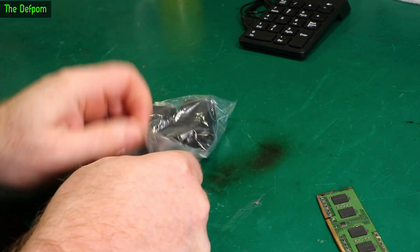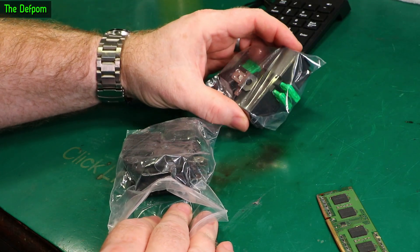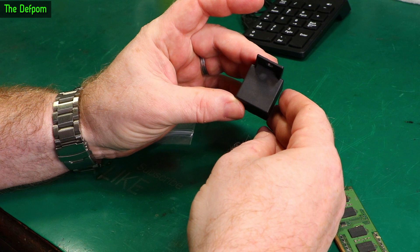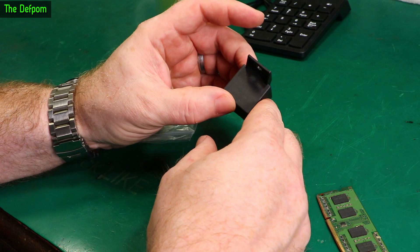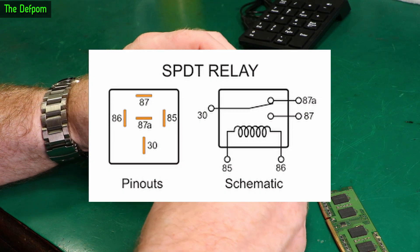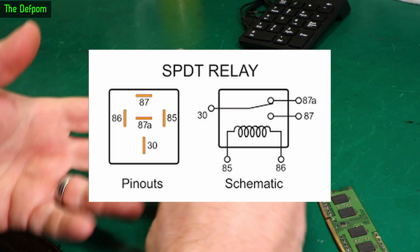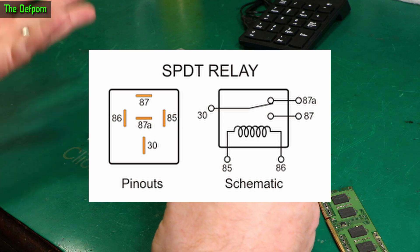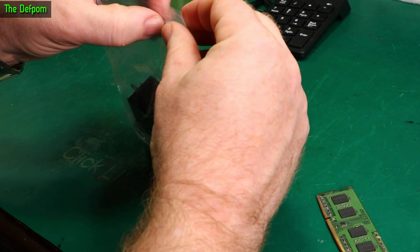Relays. So I've shown some relays previously, which are still sitting on my desk actually. I need to put these in my car. It's just a little 12 volt relay, 40 amp rated apparently, with 87 and 87A terminals - so it's a changeover relay. I just like to have a little stock of these relays. I've bought them lots of times in the past, used them all - or lost them maybe. More likely. And I realised they've run out.